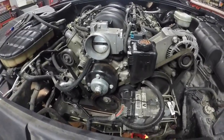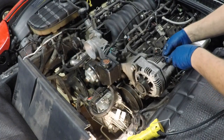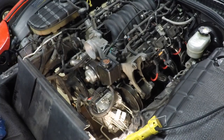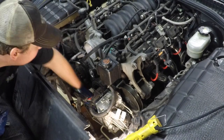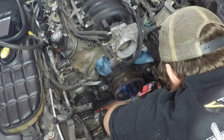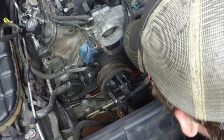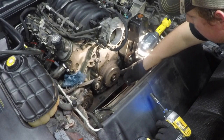With the steering rack out, there is nothing in our way from tearing apart the front of this engine. Let's go to town. First is the belt tensioner — 15 millimeter. Next is the alternator: electrical connection, 13 millimeter power cable, and two 15 millimeter bolts. Next is the water pump with six 10 millimeter bolts. Then the AC tensioner. Now we've got to crack that balancer bolt — got the car in fourth gear, 24 millimeter socket, and a fully charged impact.